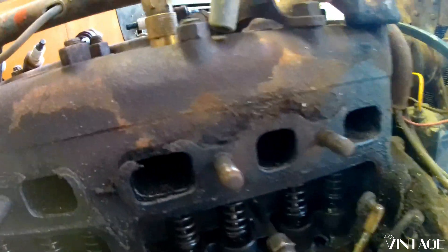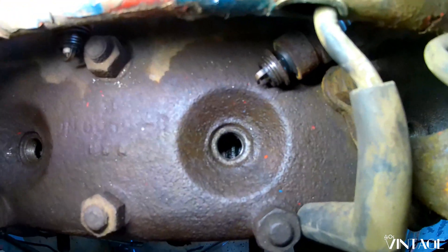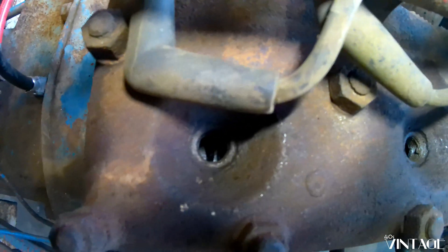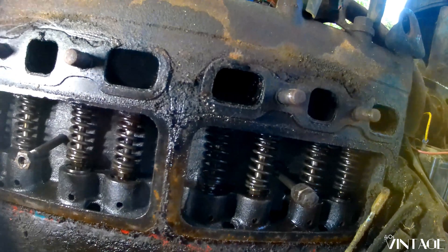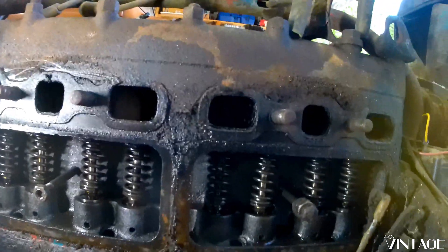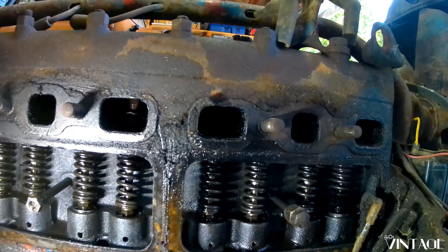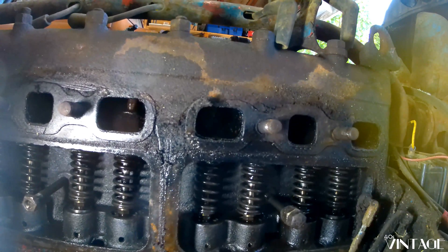Alright, so it's no real surprise that we've got some valve problems. You probably can't see it in there, but you can tell that the tops of these valves are not in good shape. So I can only imagine what the seats look like. The head's got to come off and we have to decide: are we going to just lap these in and see if we can get them to seal, or are we going to do a full grind? Do we replace the valves? Are they reusable? It's hard to say. I can see some not-so-pretty marks on the undersides and on the stems.